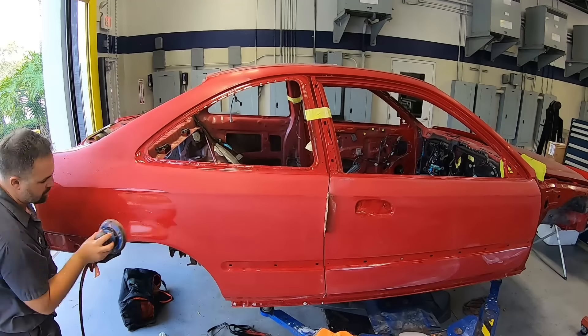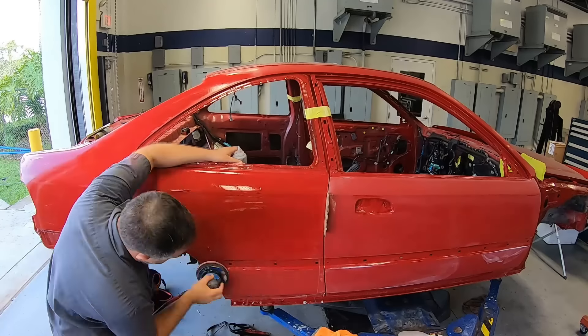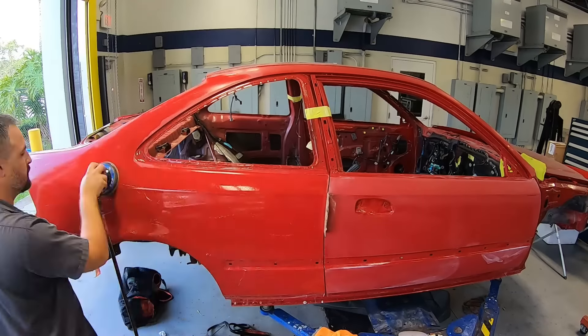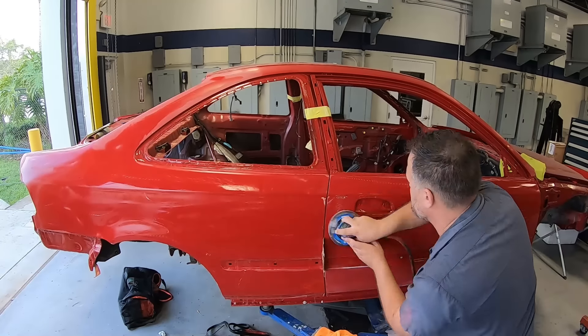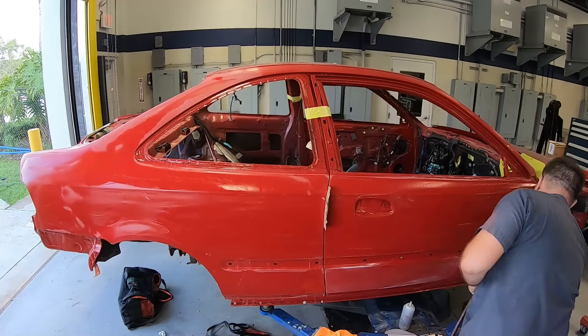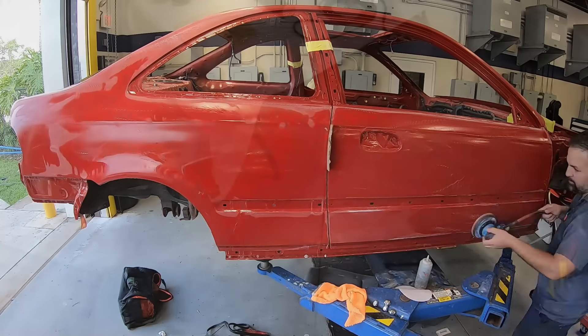There is no rushing when doing any sort of wet sanding and buffing. This was done over the course of a month — not in one or two days. Also be prepared that when you go to buff, you're going to come back a couple of days later and see some areas that still need buffing. Make sure you take your time and get everything sanded. You don't want to have to go back and sand once you're buffing — that really delays the process.